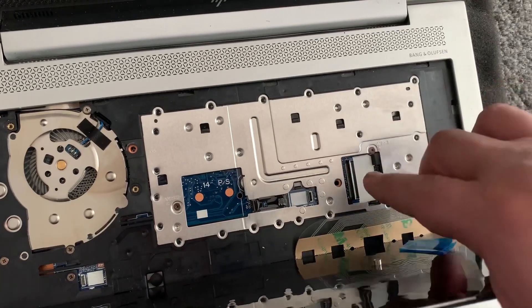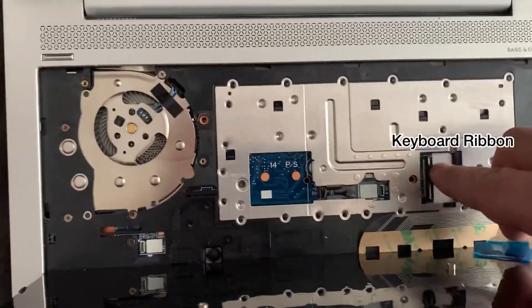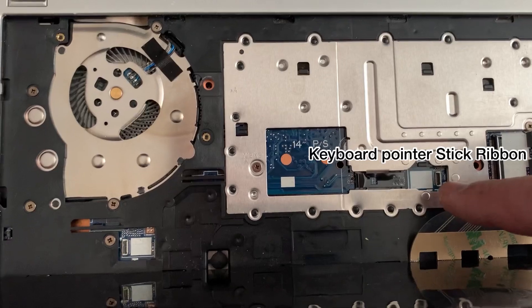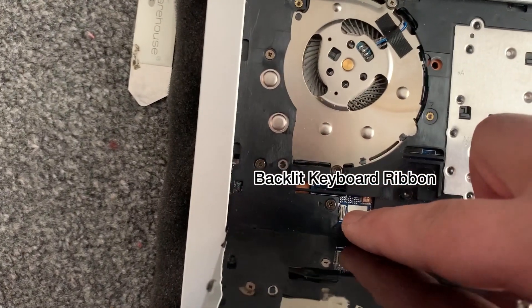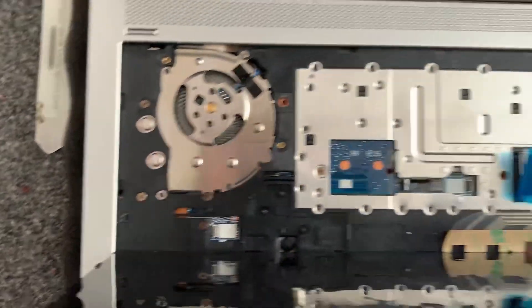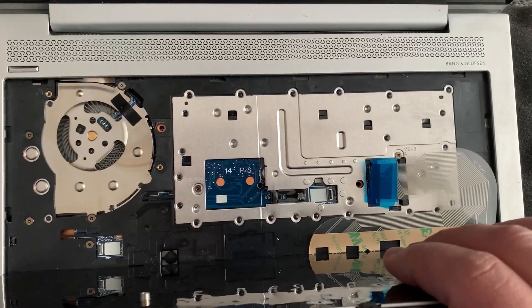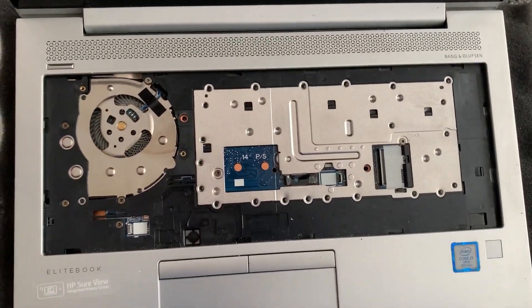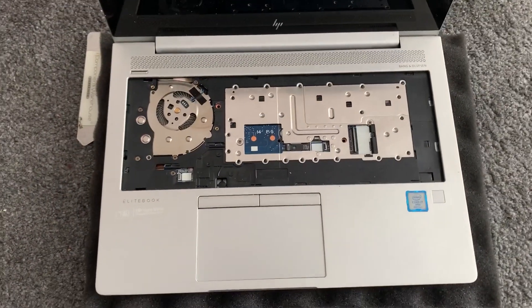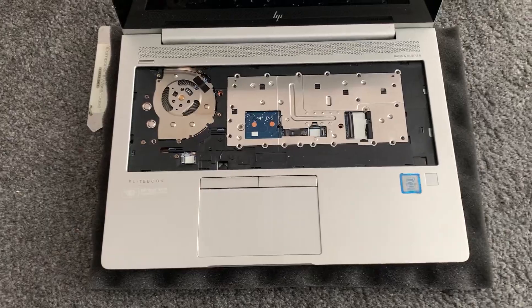Because it's not OEM, there's only one ribbon — that's the ribbon for the keyboard. That's the pointer. If you've got an original keyboard, there's also the backlit keyboard ribbon. Once all three cables are removed on the original, lift up the keyboard, and then vice versa you put your keyboard back in.